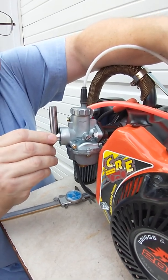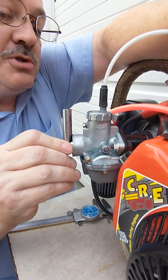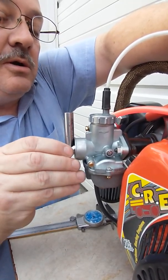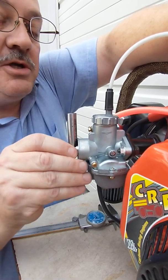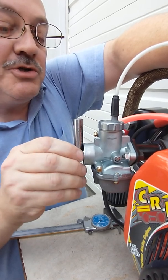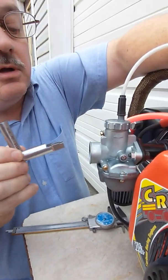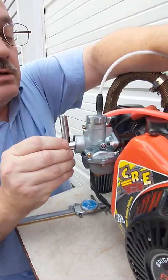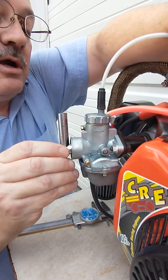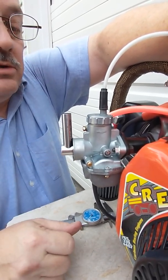Just be careful of that. And you can see, even with that cap loosened up, this one still has a fair amount of adjustment. There it did just go. You don't want to blue-thumb this and force it in there and ruin the man's carburetor — that's not the purpose of tech. We want to show that people are legal, not illegal. So I'll set that in there, and you can see that it tries to catch right there and then it just does slip past, which would make that illegal.